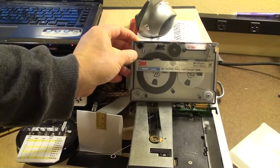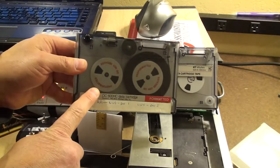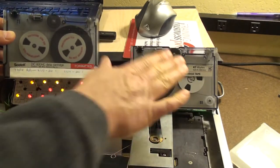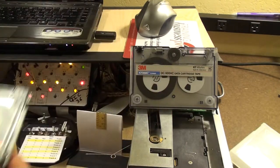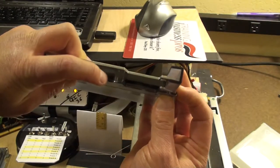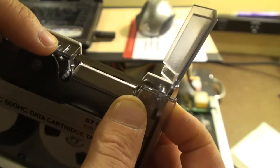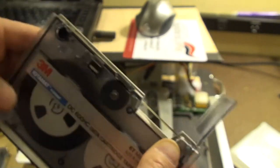This is interesting — I'm seeing something that doesn't look quite right. This tape is in the rewound position — this is the beginning. I'm curious what position it's in right out of the box. I'm glad I noticed that before I put it in. So this is actually at the end of the tape — we should see the end-of-tape holes and beginning/end-of-media markers somewhere. There is an ever-so-slight residue of the band, but it shouldn't matter because we're at the end of the tape, not the beginning.